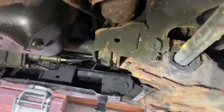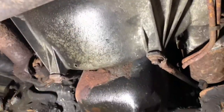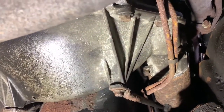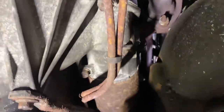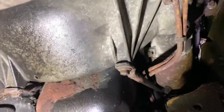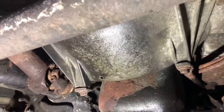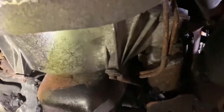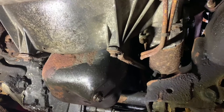So now there's the starter — it has two bolts there. I'm going to take my dust cover off; I think there were six bolts total. I'm going to take that off to give me a little bit more room here because my tranny lines aren't looking very good. I'm going to try to finesse that thing out of there without breaking anything, because I really don't want to dump a bunch of money into this — it's just my beater car more or less.